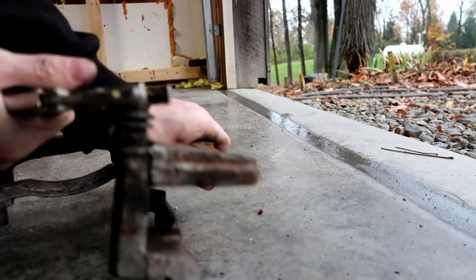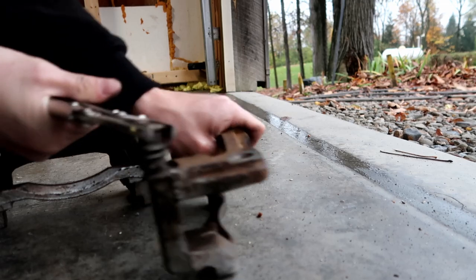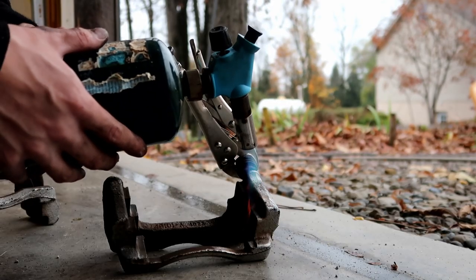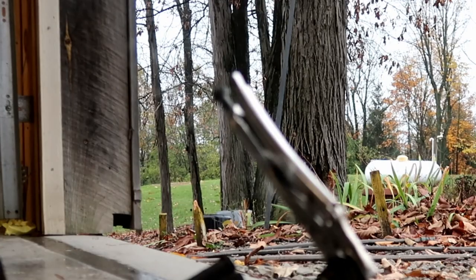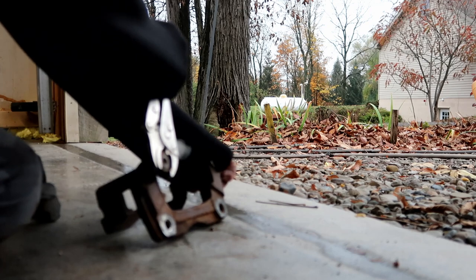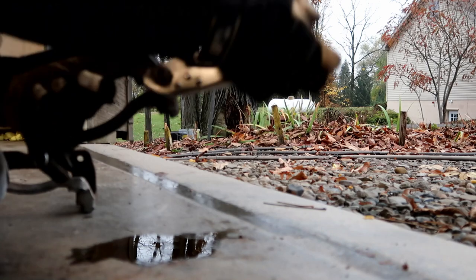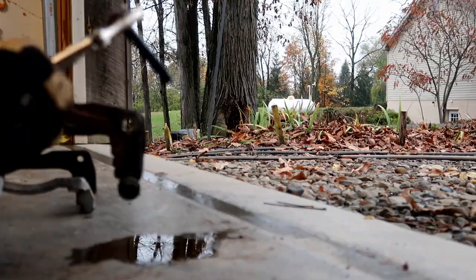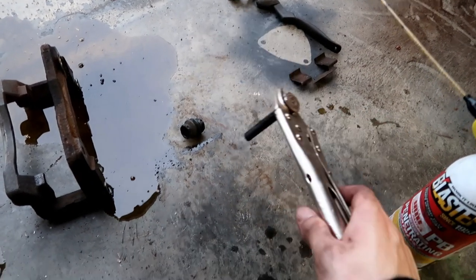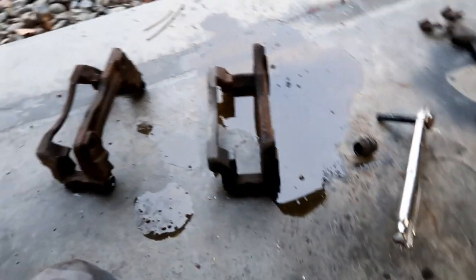This pin just isn't coming out. Finally — holy crap! This pin was super stuck in there. I did not expect that to happen. That would explain some of our weird brake wear as well. Got them soaking in some PB now and we'll get them cleaned up. I don't want to reuse those caliper guide pins and I probably should have thought about grabbing some new ones.